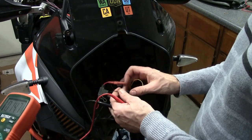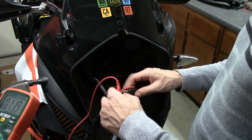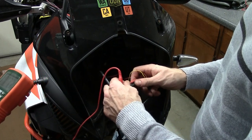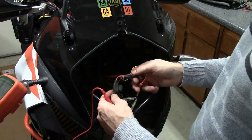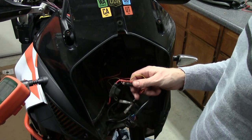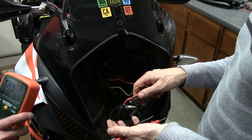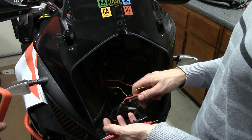And so that allows my GPS to charge when the engine's off, etc. I think you could probably use either one. I believe ACC1 is, well, actually no, I think ACC2 is higher amperage, but I think it doesn't really matter. I'm going to use ACC1 again, because I just like having that availability of having my GPS powered all the time, even if the battery's off, especially because if I turn off the engine, then the GPS immediately goes, lost power. Oh, I want to turn off, and I don't want that.